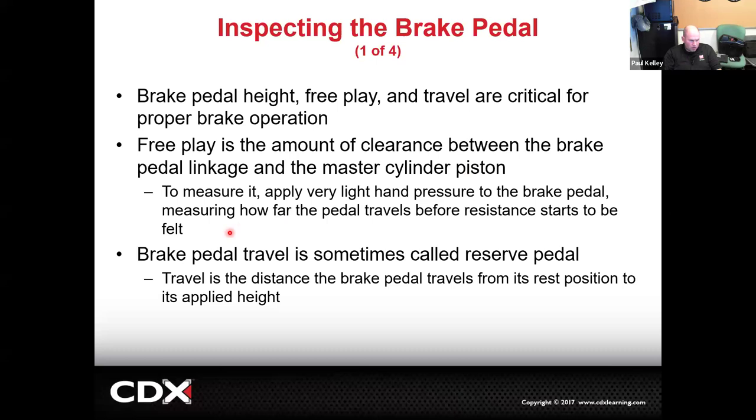When we pulled brake boosters out and people had the adjustments all messed up on that brake pedal push rod, if your push rod is too tight, your master cylinder will have no play. There'll be no wiggle. And that's a lot of times when the brake lights are stuck on. If you really have it out, your pedal will be released, your push rod will bottom out, but it's so long, it's still pressing the master cylinder. That's how you know you screwed up.